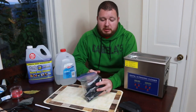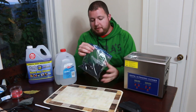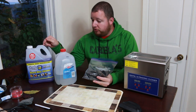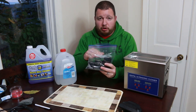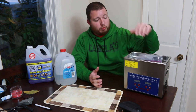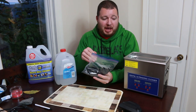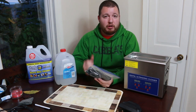Here is a little tip that my buddy Mike told me about. He does all of his stuff in Ziploc baggies — this is a really cool idea. It works really well for carbs too. He uses Simple Green heavy duty cleaner, 50% of that and 50% distilled water. Fill the baggie up so it covers just your parts. Then take the entire baggie and put it in your sonic cleaner with just normal tap water, enough to cover the baggie. What this does is it keeps all of your dirty, cruddy crap inside the Ziploc bag and doesn't get your sonic cleaner all messy.